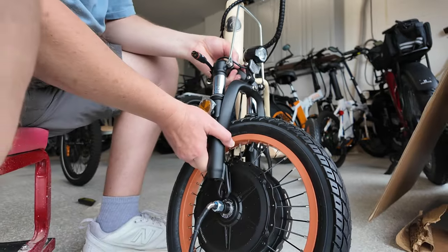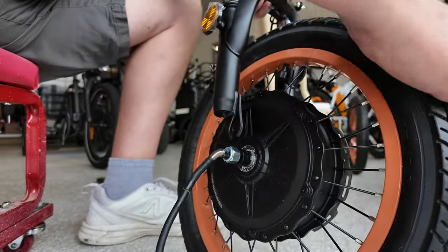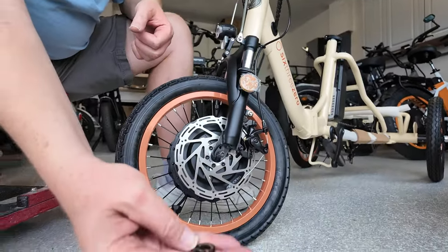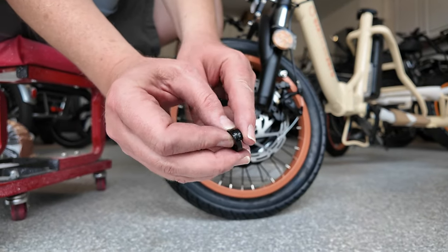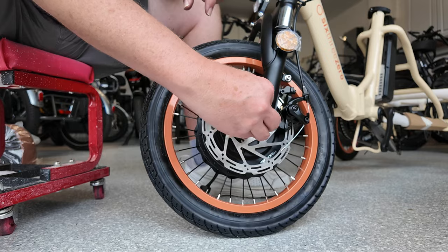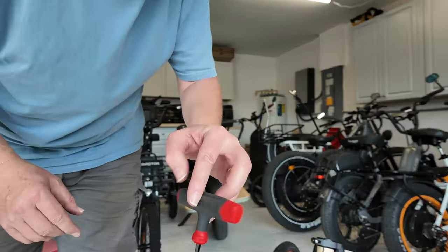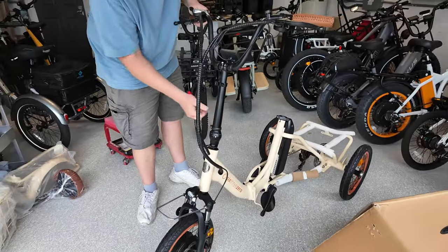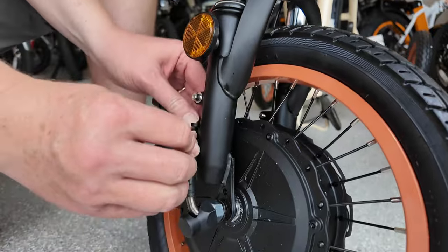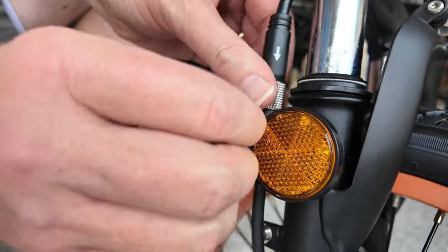On the axle right here there's a special little nut that's kind of squared off. You've got to make sure that's spun the right direction so that your fork will actually sit down on top of it. Here's what I was talking about — that special little washer that's got this little notch right here, that piece that goes on the bottom of your fork to fill that gap. Get it locked in, line up the arrows, get that in, and tighten it down.